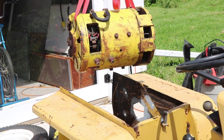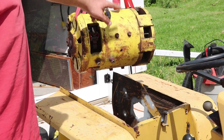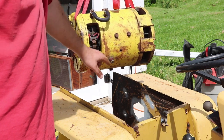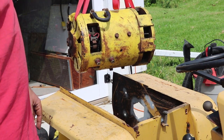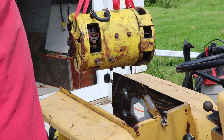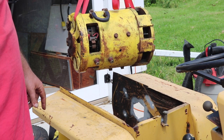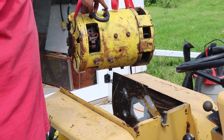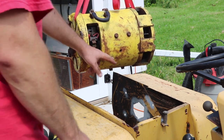I'm getting ready to put the motor into the tractor, but before I do, a couple of things to think of. One is just where I connect the power — I'm choosing to go to these two lower connectors because that's going to be very hard to get at once the motor is down inside the tractor. Another thing to think about is reversing. I don't have reverse on this yet, I'm just trying to get it up and running, but if I want to add reverse I'll need to add some more cables. I'll want to make sure to use some sort of a short pigtail or something so I can still get access to this.